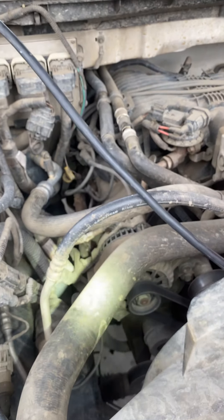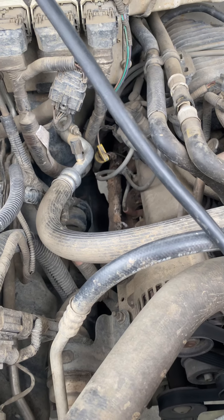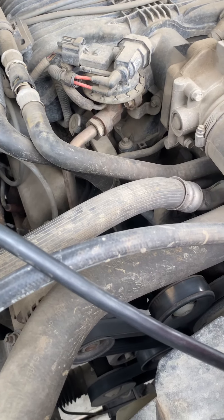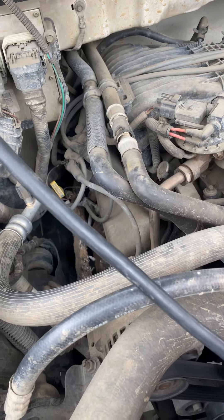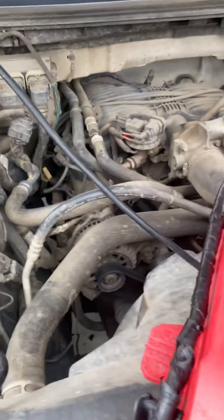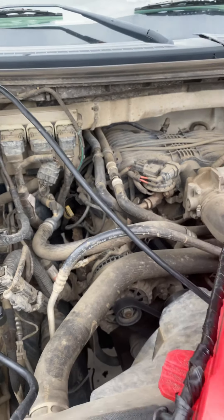Hopefully you got a picture there. Obviously that's why your fuse keeps blowing out. So pretty much just pull it away, replace the fuse, fix that pigtail — get it away from that EGR pipe tube. It should start and you should have a happy customer, or save some money. We've got a charger here because obviously the battery is dead — haven't tried it yet.